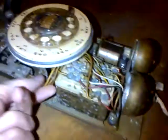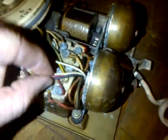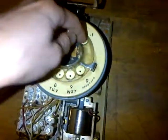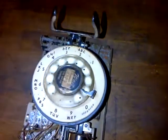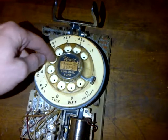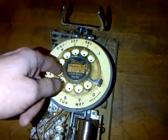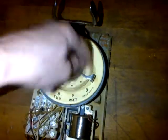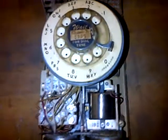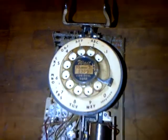So it's pretty cool. They used a lot of older parts when they made this because these are cloth. There's some mixed — cloth and then a couple newer ones. I'm very happy with the internal parts of this phone. The rotor — you can see — it's not the way it's supposed to go. Right now I'm guessing that if I dial a five, it's probably going to register a four or six or maybe nothing at all. It's timed how long it takes to come back. What's really cool about this phone is it has the original center piece with 'wait for the dial tone.' Pretty cool — it shows it's pretty old.